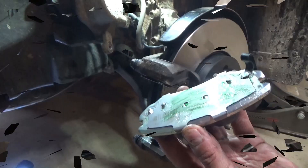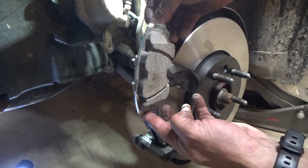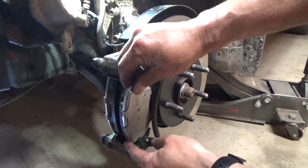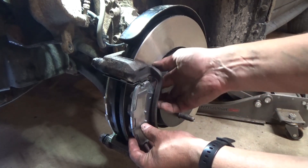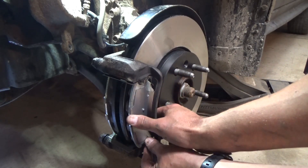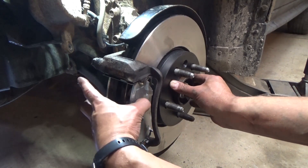I applied a thin layer of grease on the back of the pad, just where the piston of the caliper meets the face of the pad. Get this in place, and obviously try not to get any grease on the pad face or the rotor. You may need to take your finger and pull this tab back a little bit — it's supposed to be springy to provide tension on the pad so it's not just flopping around in there.